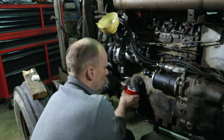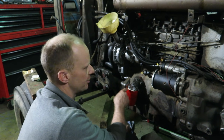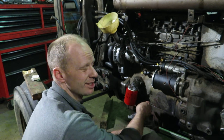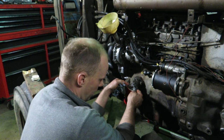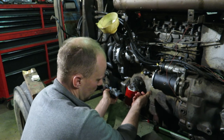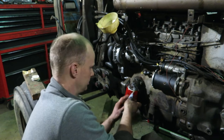But if you have an empty oil filter and you start it up, the oil pump has to fill the filter first, and that's that much longer that the rest of the engine isn't getting oil. So basically, if I can put the filter on straight up and down, I fill it with oil. If it's sideways or upside down, I don't worry about it.